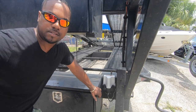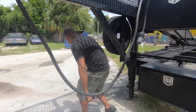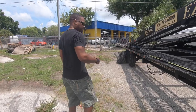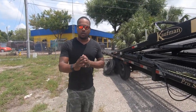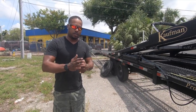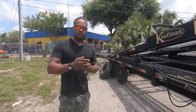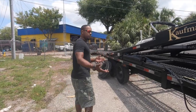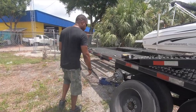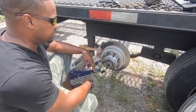It's going to save me brakes on the truck and it's going to be easier to change the brake pads. With the electric drum brakes, it's magnetized — only when the wheel is spinning a certain way does the magnet grab the drum and clamp the brakes. But they wouldn't work in reverse because the magnet didn't go both ways. If you know about drum brakes, you understand what I'm talking about.